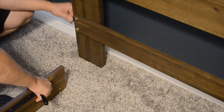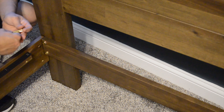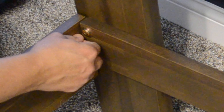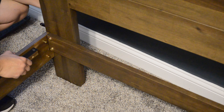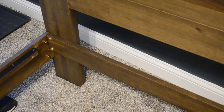Doing the same thing on the other side - now that it's stabilized by the other side, you can use the dowels to hold everything in place. Grab your little stud that needs to go in, click the bolt through the back, and start getting that started. Upper bolt in, same thing for the lower bolt. Now that I've got all four of them started I'm going to snug these down. No washers on the back side of these bolts by the way - just snug it up, don't over-tighten. Do the same thing on the other side.